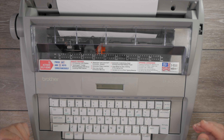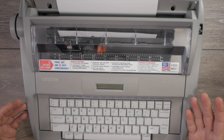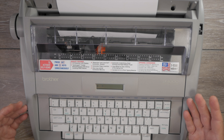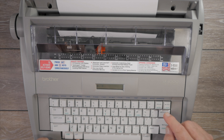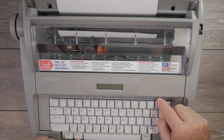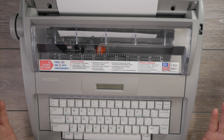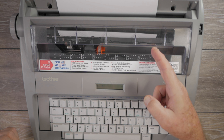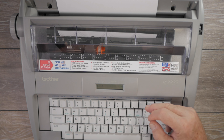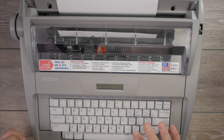There are a couple of other operate modes on these typewriters. One option is auto carriage return mode, accessed by holding Alt and the Operate key. In auto mode, there's an arrow pointing to it in the display. Auto mode is similar to manual mode except that in the 'hot zone' — between the beep and the actual margin stop — if you type a space or a hyphen, it will automatically do the carriage return for you.